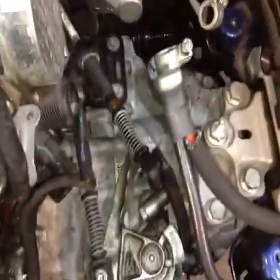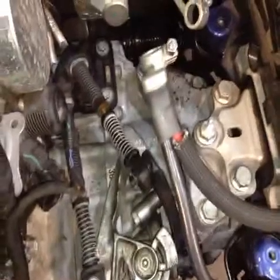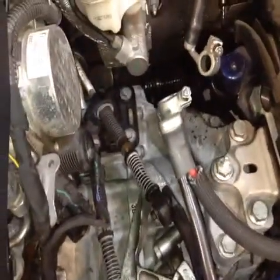So what I found, the vehicle has electronic power steering. What happens is, in order to remove the clutch, the transmission comes out. In order to remove the transmission, the subframe would come out with the steering rack attached to it.